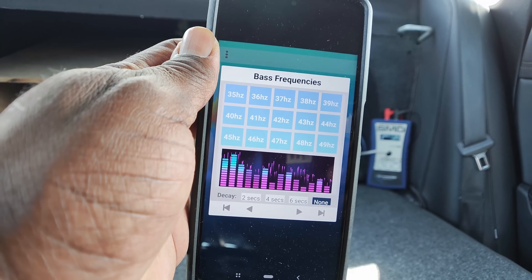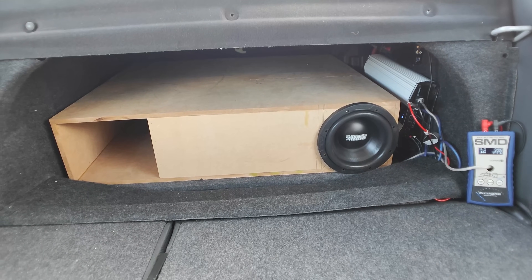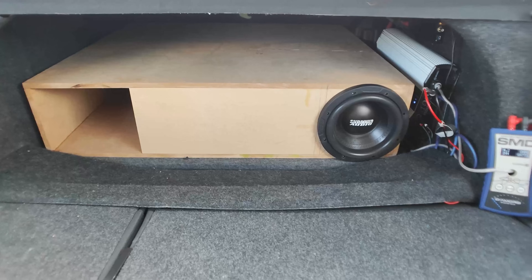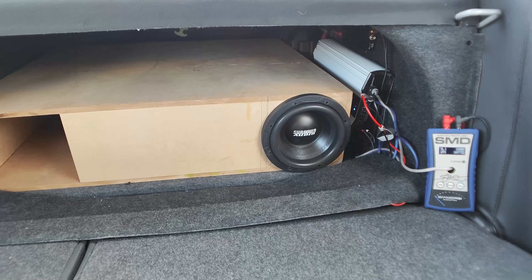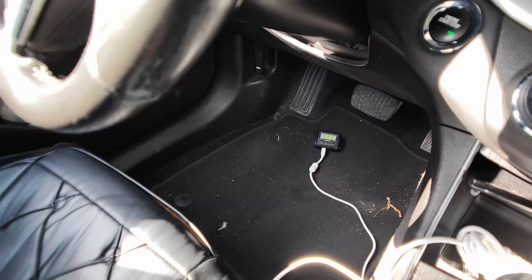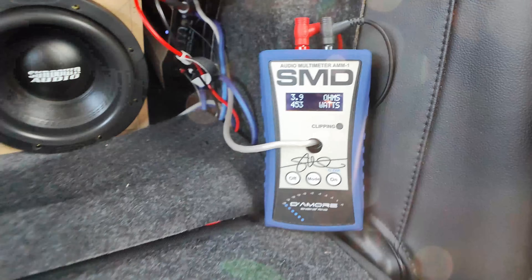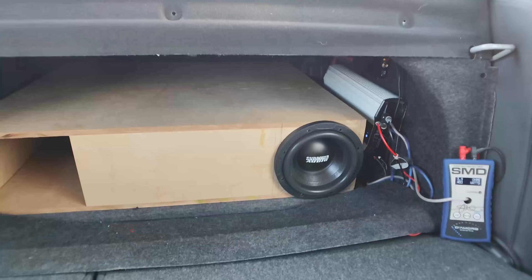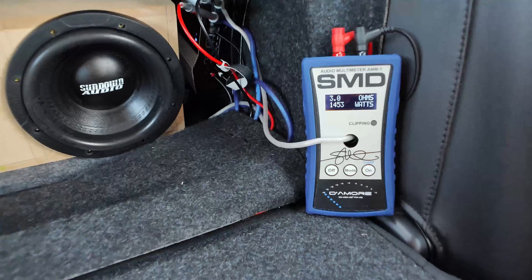This app right here is what I burp with, and we're going to try this at multiple frequencies. Coming up first, it's going to be 35 hertz. Wow, that was very, very low. Look at that — 144 watts got us a 130. Can you believe that? 144 watts. Let's turn up the bass a little bit — put it on 44. There we go, 291 watts, 130.4. Let's try 46 this time at 35 hertz. That sounds so good — 453 watts, 132.3. Let's go ahead and put this on 50 to see what it can do at 35 hertz. Wow, God damn — it bottomed out before ticks. That's a 134, but that's a horrible score because it bottomed out. You've got to be careful with these horns.